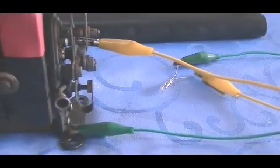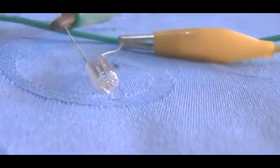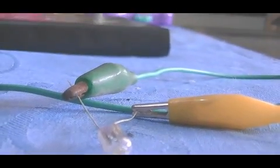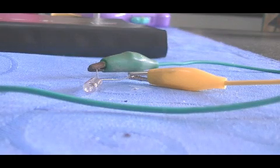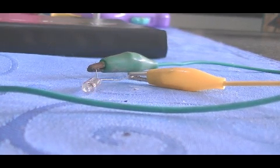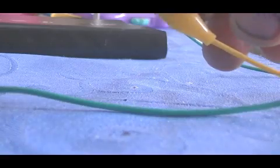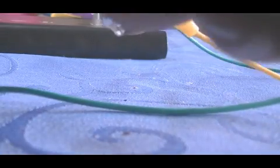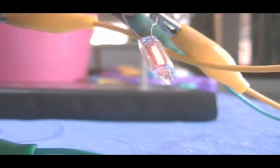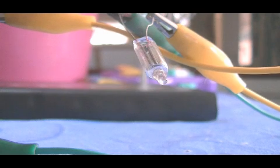You can see just by a simple movement — it doesn't matter which direction. I'll try and set it down here with something under it and put some light on the edge, and crank the handle. Because of our uneven movements in the cranking, we get that voltage and current surge, which of course lights it up — simply by the points opening and closing, which creates a short and then an open circuit across the coil.